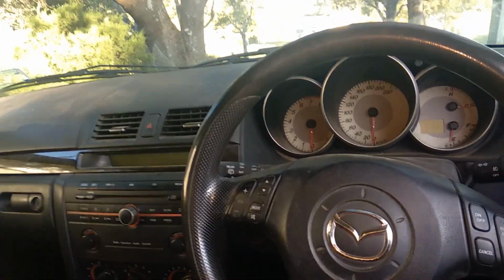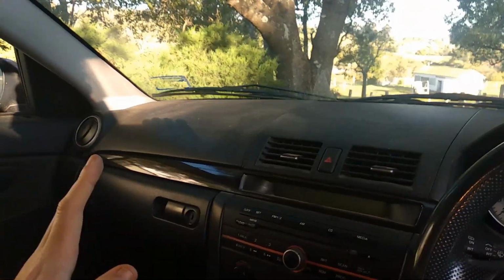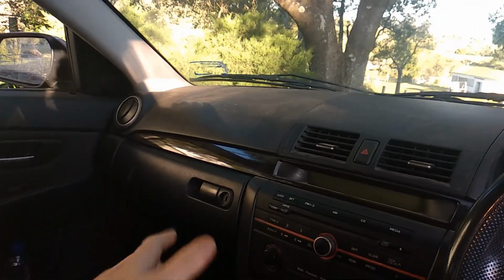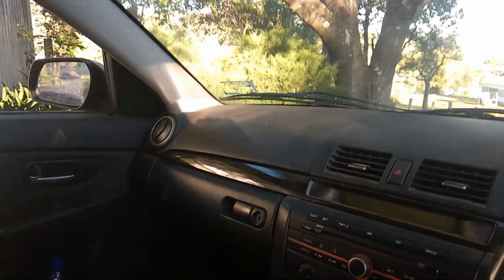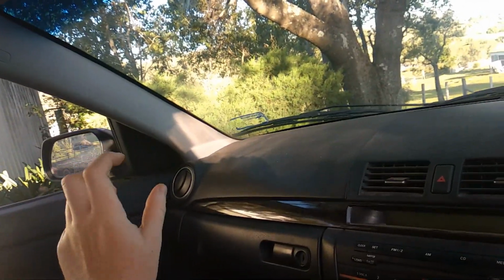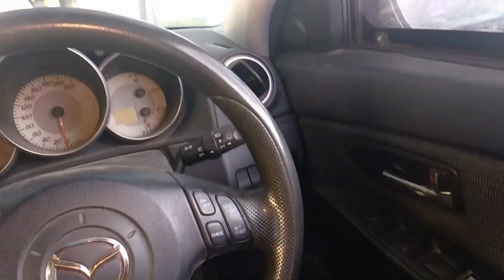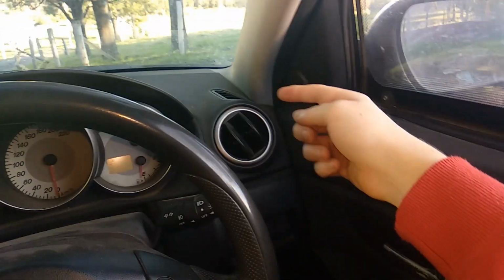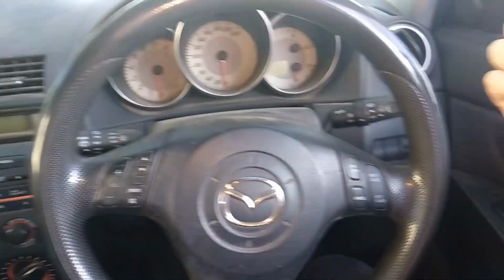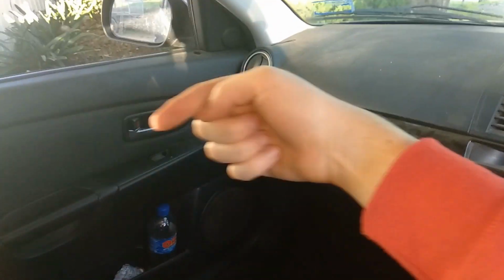When I try to work out how to fix it, I might put some sort of grill over the front of the tweeter, like you can see in some high-end speakers, just to help with dispersion. I might try to do that just to get rid of the beaming. I also could angle the tweeter more towards my left ear, and if I angle both tweeters in, it should make it a bit louder. I'd still do the effect of aiming this tweeter at that ear and that tweeter at my ear, rather than, right now they're straight across, pointing them straight at the closest passenger.